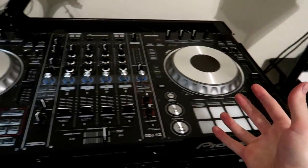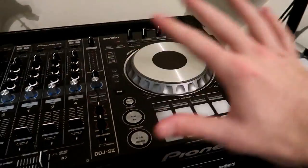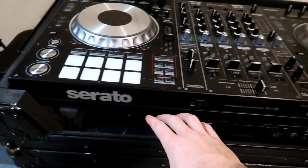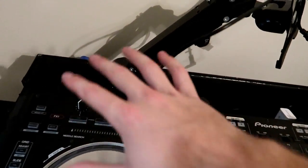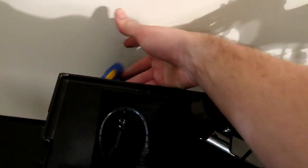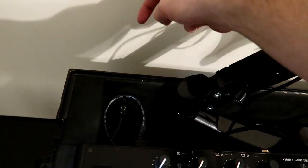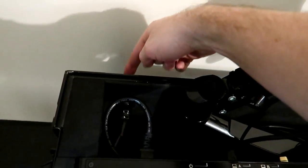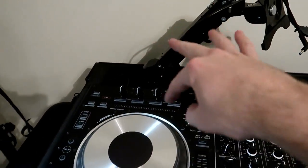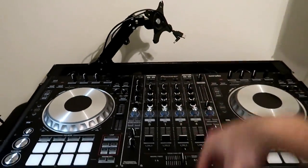Here is my Pioneer SZ — as you guys can see it is pristine and clean right now because this whole process has been finished and the whole case has been cleaned. First off, make sure power is unplugged. Pro tip: never unplug a power connector that has power going into it like that. Always unplug from the outlet first, then unplug the power connector. It's in the manual.